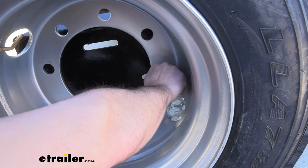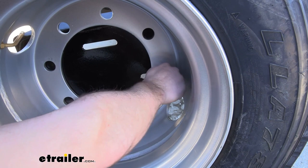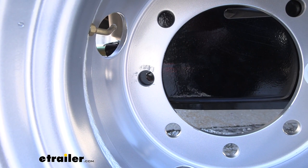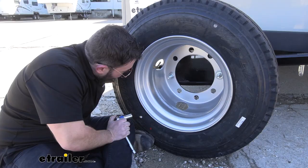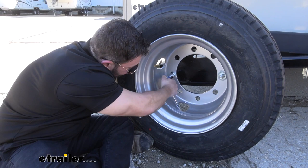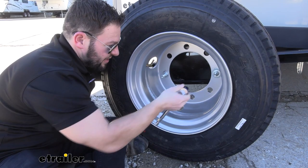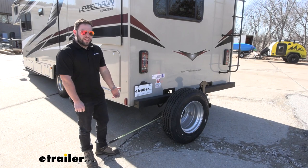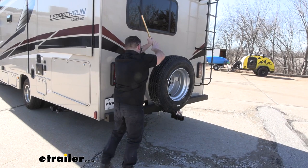I'm going to do it hand tight, and then we'll get our second bolt installed too. Lifting up the handle, we will line the hole back here to be able to run the bolt right through and attach this one as well — with the plastic washer, flat washer, lock washer, and nut added on. Then you can come back and tighten the bolts down using a 7/8 socket, with a wrench on the back.